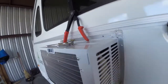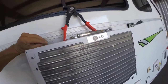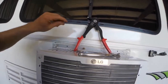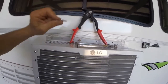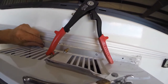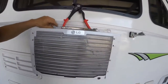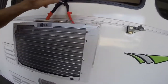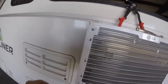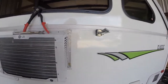One, two, three, four rivets in. If one won't go in, just take your drill, put it in there for about a second — just the tip, not all the way through — and you'll clean that up. You can move it to a different location; as long as you can get it in, that's fine. Push the whole unit in while you're doing it, or have someone help you. Pull those Clecos out — they should all fit. Pop them and you're done except for reinstalling your top bracket.